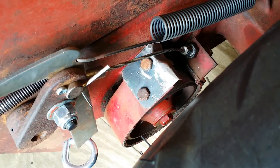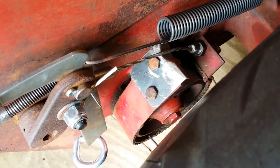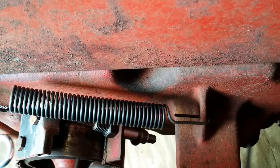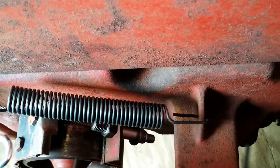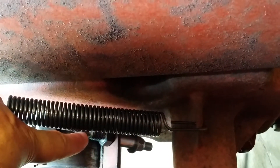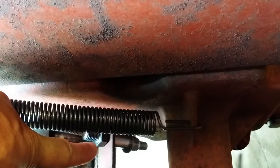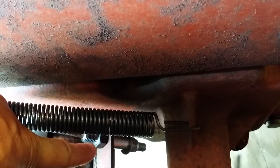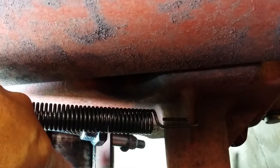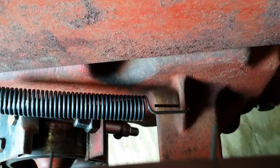From this position you can see the piece of threaded rod — the cable is soldered directly into it. I have a nut soldered on the end so I have a nice solid mounting point, a steel spacer, and a nylon nut so I can make adjustments. That is basically how I got this to work.